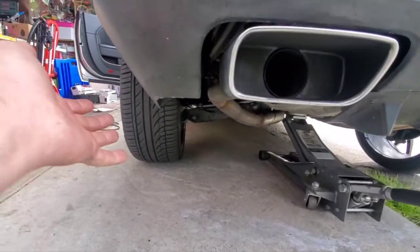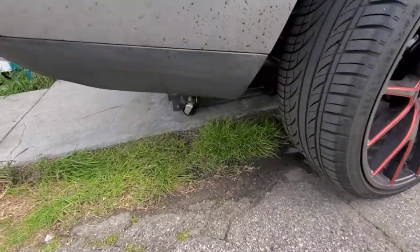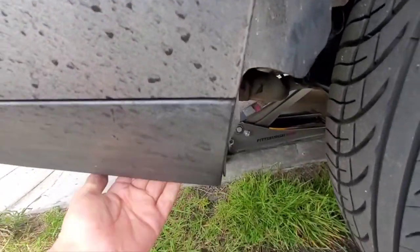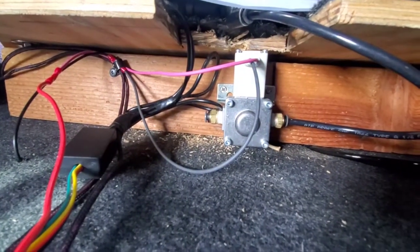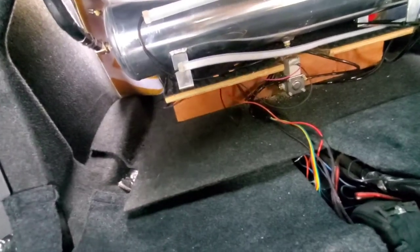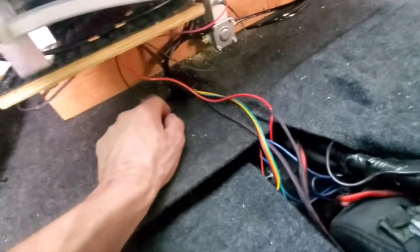I got the car up. Now I'm going to decide where I'm going to put the Schrader valves. There's my car — I'm thinking about right here, but I got to worry about the exhaust though, which is right there. I got the line from the tank into the valve. I'm going to run a line from the left side of the valve out to the car and probably run a T-splitter under the car so I can make one hole versus making two holes. I'm going to use a quarter-inch drill bit and drill a hole right here so I can get the line to come out and down into where the spare tire goes, out to the outside of the car, and run a T-splitter.